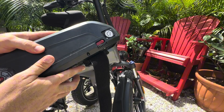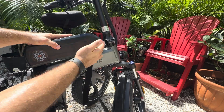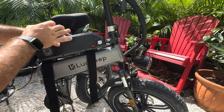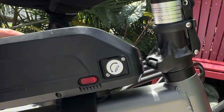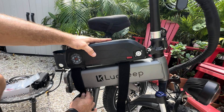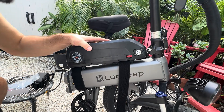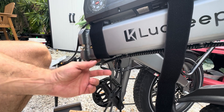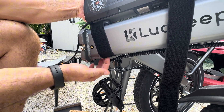I like to make sure my straps are on the same side for uniformity. Let me put this battery back on and lock it in place. What I'm trying to do is avoid any issues with steering, so I'm going to back this off just enough — you can see the gap right there at the knuckle at the joint of the folding stem. I need to pay attention to how my straps come under, trying to avoid the keyhole up front and making sure to go under my wires. I covered the keyhole here, but it can be slipped forward, and I'll give it a final tightening in a bit — it's still easy to undo.